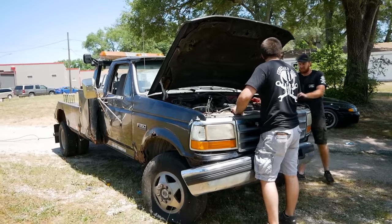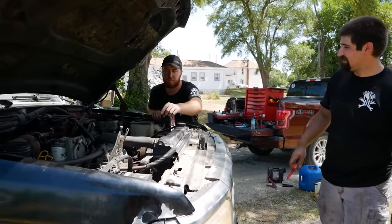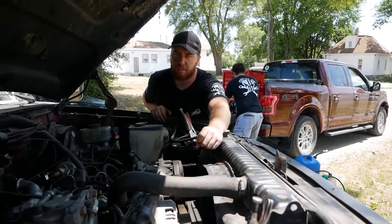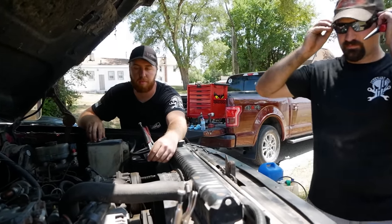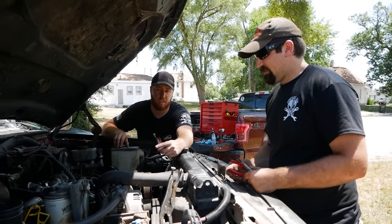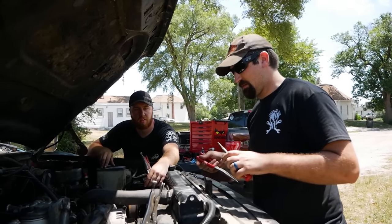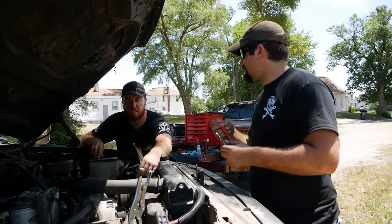Let's try that. So we got our fuel line set in. We did some electrical fixes on that hydraulic clutch. We're going to see if that sucker works. But first, what we're concerned about is we probably got like 3 feet of air in the tank line that's going to be pumped up if it picks up fuel. So Wyatt's going to do whatever Wyatt's going to do to deal with that, to keep that from hopefully airlocking our fuel system, which now works. So hopefully I can do this without it locking. I'm about 50% certain I can, 50% certain I can't. We'll roll the dice.